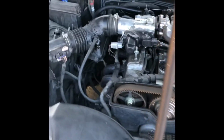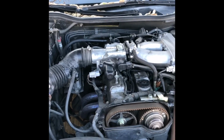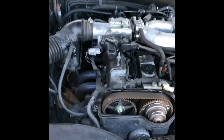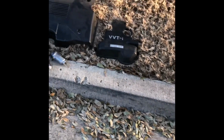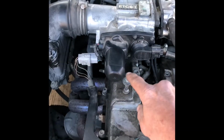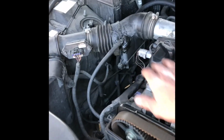Okay, well, I just turned the car off, and when I went inside the car to turn the car off, I played with the gas pedal a little bit. I went up and down with the gas pedal a little bit just to make sure I liked it, and I do. Sounds good. So if I was done with just replacing only the air control valve, all I would need to do now is to replace the timing belt cover and those 4 little Allen head screws, and the big plastic cover for the top of the motor. It just falls right into place, and you got one here, you got one here, and you got one back here and one back here. So in any event, if I was only doing the air control valve, I'd go ahead and put that back together.